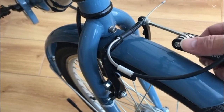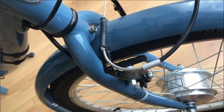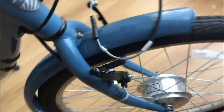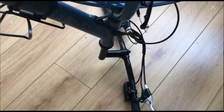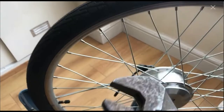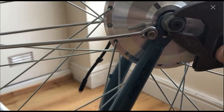There we go — that's that done. And that's it — the wheel is now free to drop out as soon as we've slackened off these nuts. As you can see, the bike's now upside down, resting on the floor. Gently done, no problem. The controller is very firmly fixed — there's no damage there. The brakes are released. The spanner I'm going to use is the shifting spanner, which is in very good condition, so it's not going to round off the nuts. And I'm going to start with this side. This is an 18mm nut — the only size that's not available in the socket set I've got, which was brand new, purposely for bikes.